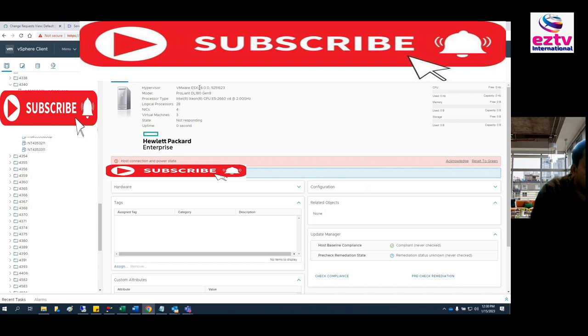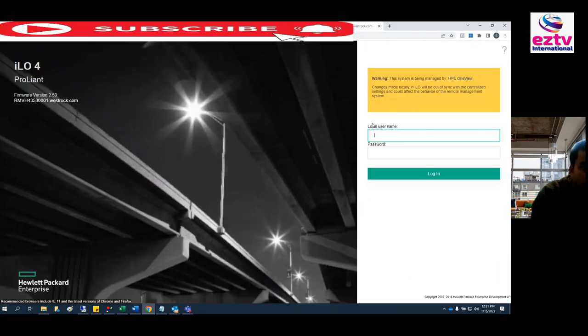My target is to upgrade ESXi from 6.0 to 6.5. This is the HP ProLiant DL180 rack server, and the 180 has some limitations. It's a pretty old model, so you cannot upgrade to ESXi 6.7 or 7. You can run up to 6.5, so our target is to upgrade to ESXi 6.5. But before you upgrade, you have to do the firmware update, because you have to check that the firmware is up to date. You log in like this, and then you can check the version, right?